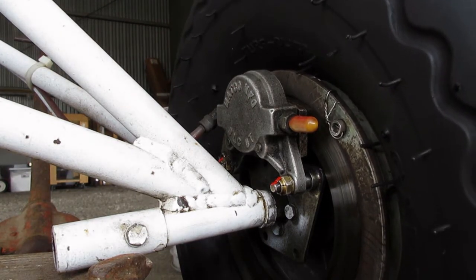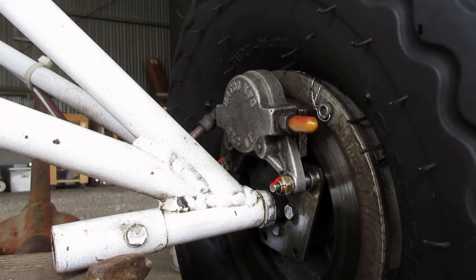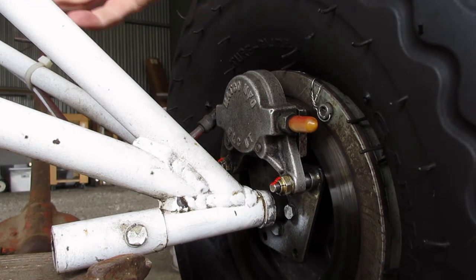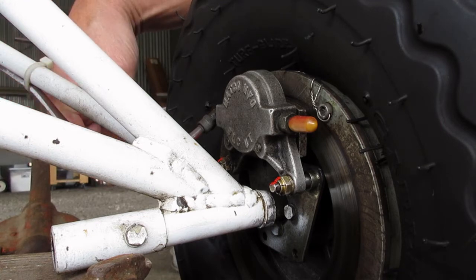I've since cleaned it out and changed all the fluid, but I suspect it's done its toll and the O-rings have gone bad. The stock O-rings are Buna N, which doesn't hold up to brake fluid. I'm just going to pop it apart, put new O-rings in it, see what's going on, make sure everything looks good, and away we go.